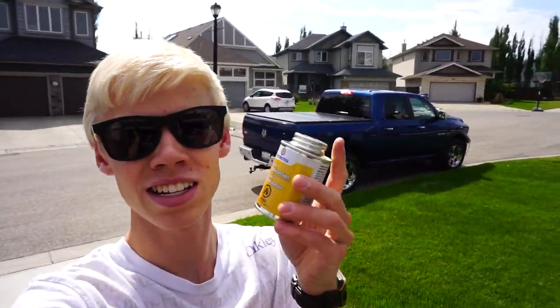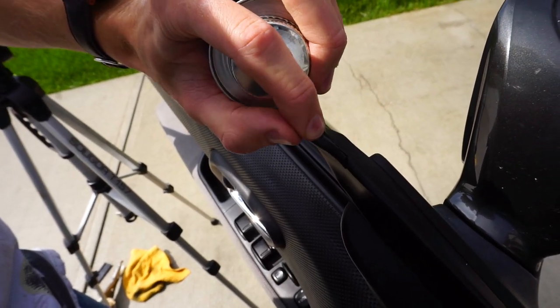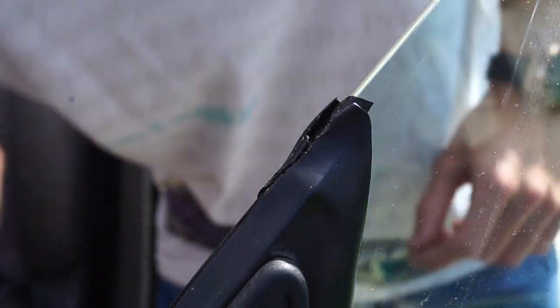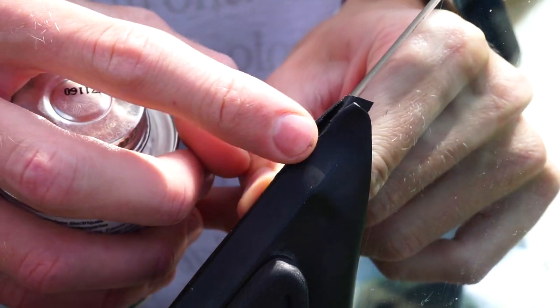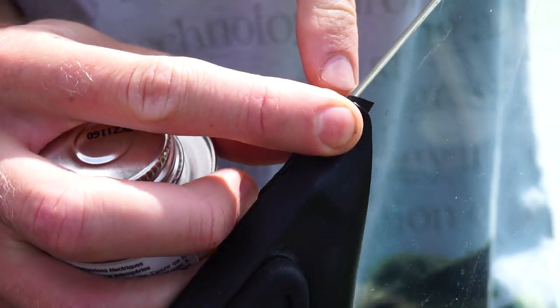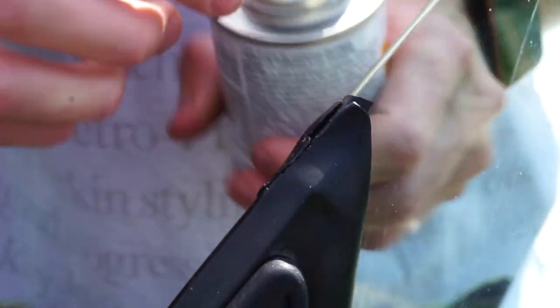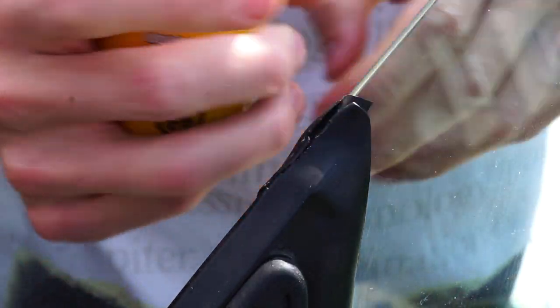Now it's time to fix the little bit of rubber grommet that's broken, and we're going to use some liquid black tape - I didn't even know this existed, but someone suggested it on a forum about fixing it and it supposedly works really well. So what we're going to do is put it where it'd be with the window up and then liquid black tape it. I put a little bit of black tape just to set the frame for it, and then we're going to use this liquid black tape all along here. This tape here is just going to be peeled off - it's just to hold it together while we apply the liquid black tape. This stuff you have to do multiple coats, so I'm going to lay the first coat.